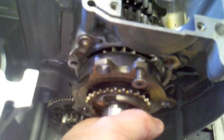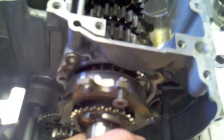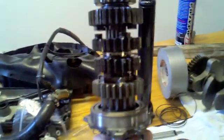Now these are torqued all the way down — I can't turn it anymore. I should be able to jostle this thing loosely. I just finished torquing those bolts down a little bit and pushed this transmission out, so now you can see it's free. I've got one shift dog down here which it looks like you need to extract and pull out — that's the lower one. And then you can pull this out. Be careful, I think these gears will slide right off the end, so you want to hold it upright like that.